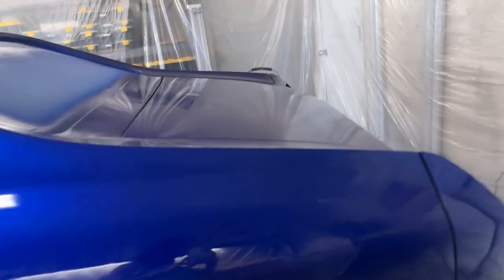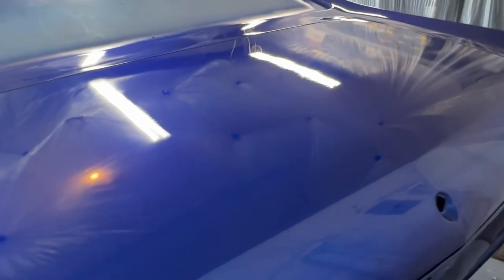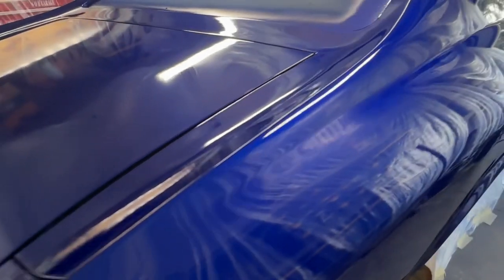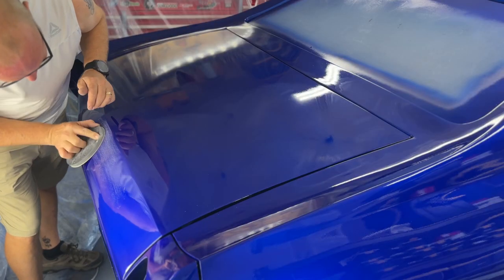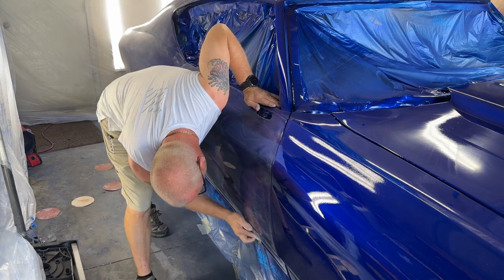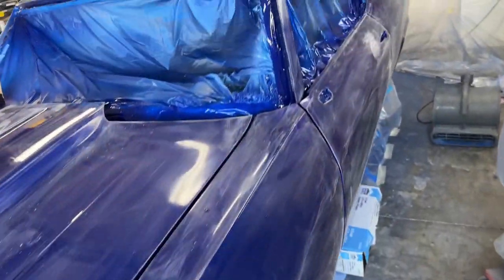The sad news is this was only two coats of clear, so I had to scuff it and shot another coat of clear. I was feeling ill. So my beautiful wife went out there and shot this video for me so I could see my car, because I was like, 'Can you please just go take a video?' Oh man, that hurts so bad. So what I ended up doing is scuffing the car with 600 grit, 800 grit, and then some 1000 grit too. That just makes the paint bite a lot better. You've got to get it nice and smooth.